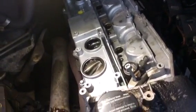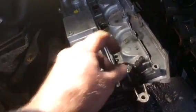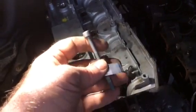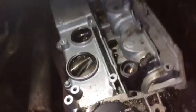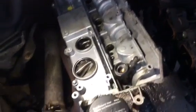And this top one here, I would recommend don't spend weeks soaking. Don't spend days hammering with a slide. Just whip this little bridge device out here. These long bolts here, they're throwaway bolts, but just keep the bridge there. You have to take those out before you can pull the injector, and if you're lucky the injectors will just slip away, but of course I wasn't lucky with this one.